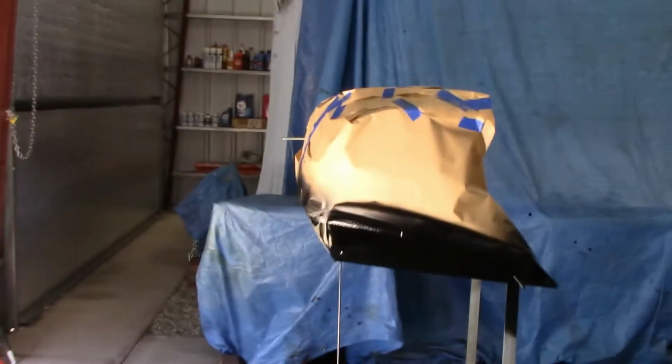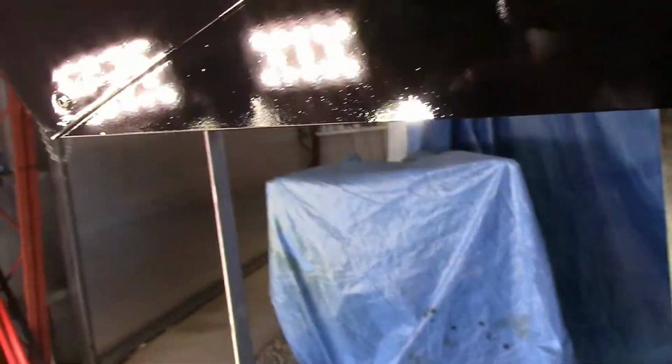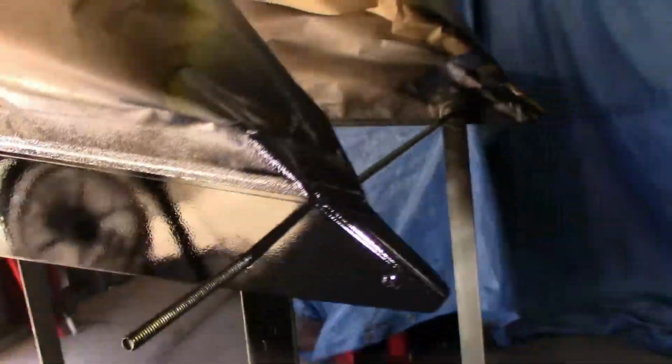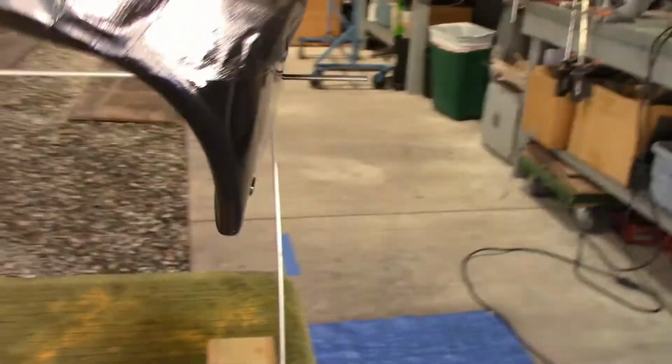Okay guys, this is 3 coats, but the last one heavy. So it looks pretty good. Good coverage. Being real careful. That up in there was a pain, and this little split right in here. Didn't want to run it, so did all right. That's a good thing about the acrylic lacquer. It starts to kick off and dry fast, so less chance of a sag. But no, it's got good coverage. It's nice and glossy.